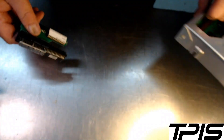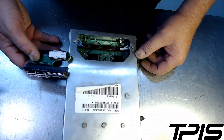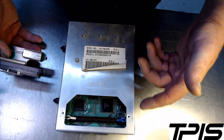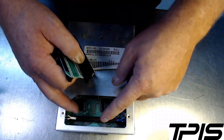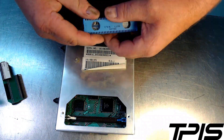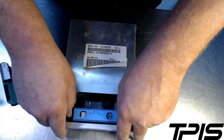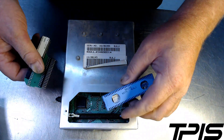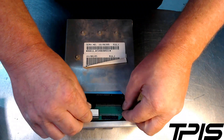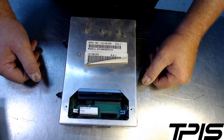This ECU would be found in a 93 to 95 Chevy truck, typically with throttle body injection. These are a piece of cake because they've got a ton of opening on them. Take the cover off, pop these tabs out, and it pushes the memcal out. We'll try putting this in without taking the blue cover off — it should go in, but it's just easier to do it without it, especially if you haven't done it before. Just push that in, and that's what you need to do.